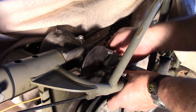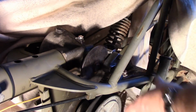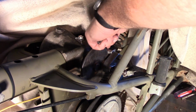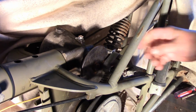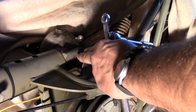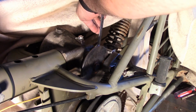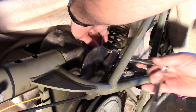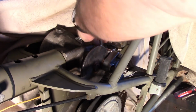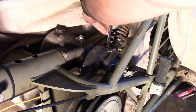So, the brakes are tight. So tight that they're not letting it rotate. And I think what I need to do is have a little spacer here. Technically I probably shouldn't have a spacer, but I want to put a spacer in it so I'm not having to shave the brake down in order to make the pads work. That might be just what I need.